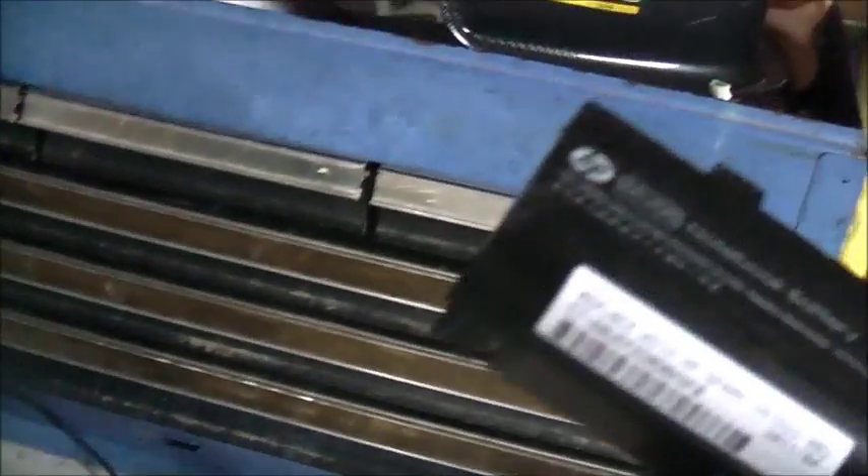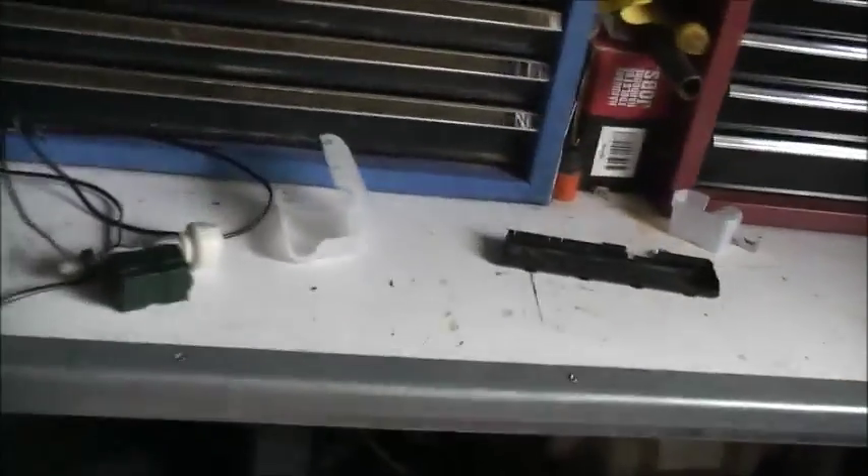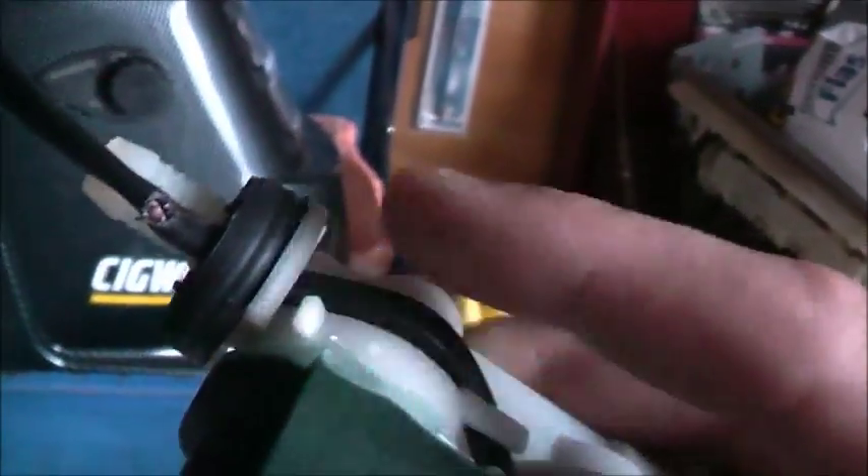Water will have like a magnetic water meter — there's a slight connection between the water and the magnetic field. It's like a coil. When you run water through it, it's like a computer or some sort of process that reads the water flowing through a coil, like an inductor of some sort, and it picks up the magnetic field changes as the water flows through. This is probably something similar to that, but this has just got live and neutral going straight to it. There didn't seem to be anything that this plugged into — it just plugged straight into the control board. This just went straight to the mains, off the control board.